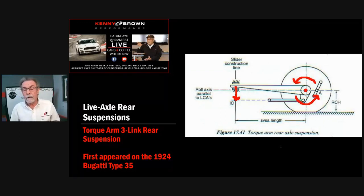And I was driving a Camaro, or Firebird, with the torque arm in there. At Putnam, I can't remember the name of the corner, but there's one where you brake really, really hard, go in deep, and kind of come around. It's not quite a hairpin, but it's pretty close. I can get around that pretty good by going really late, braking hard, and then turning in late. When I tried to do that with the Camaro, the whole back of the car started bouncing all over the place. And when I finally got through the corner, I heard this clunk, clunk, clunk under the car. So I drove back to the pits, and I told them there's a clunk in the car. And they said, the torque arm came loose. So it's something that happens to them quite a bit.